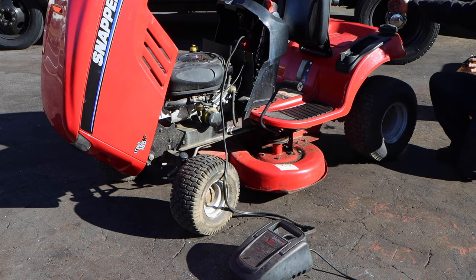All right, guys, so I'm a little lost. I admit electricity is not my strong point. So let me tell you what I do know. There are some safety switches engaged. I did bypass the seat switch because this here concerns me. I do know a seat switch has like a probe, so I wasn't sure if this was used to depress the seat switch and cheat the system. I don't know, but there is a key and I think it's connected to a bunch of safety switches, which is like grounds. Then it connects to the starter solenoid. Then the starter solenoid feeds the starter.